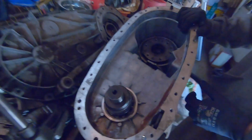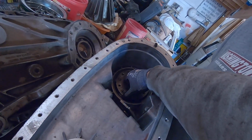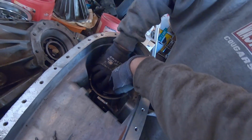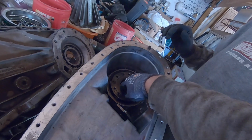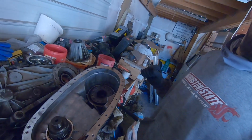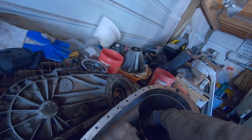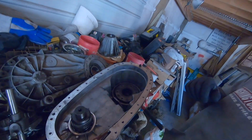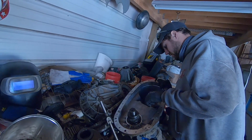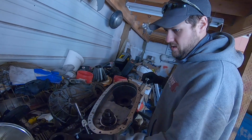Oh, gotcha. This is a 6-gear planetary. I think on my Borg Warner it's a 4-gear. Okay. And some of the NP231s I think are 3-gear planetary. What's so six better? More is better. Oh, okay. Which makes sense since this is out of a 1-ton. Yeah, that it would be. Yeah, beefier. I think for like the NP231s and stuff, you can buy a 6-gear planetary for it.